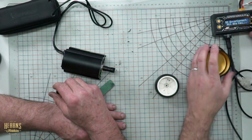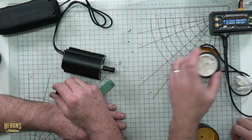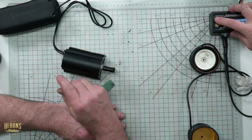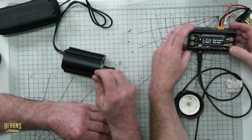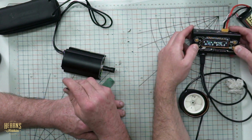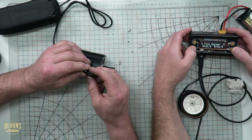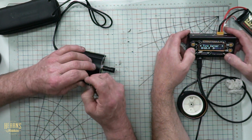Sometimes I like to just stick them on the bench while I'm working on the car. I've seen you have them on your ears. Well, only when it's cold. Now, how hot are we going to go? The last time I used this, what do you reckon? I'm 50-ish. 50 to 55 is where I run my tyre warmers at. I find if you run them too hot, it tends to overcook the tyre.